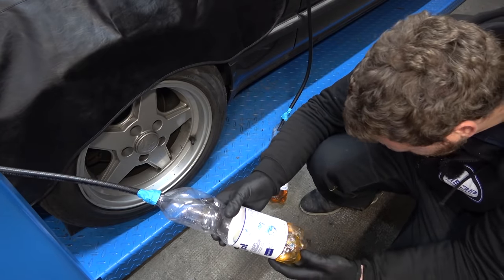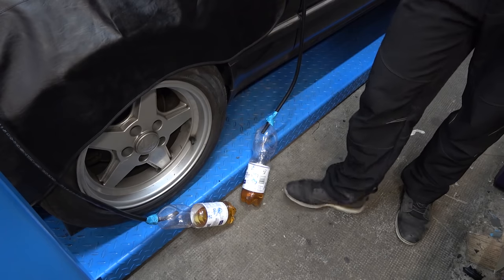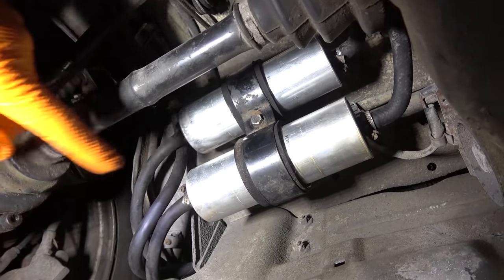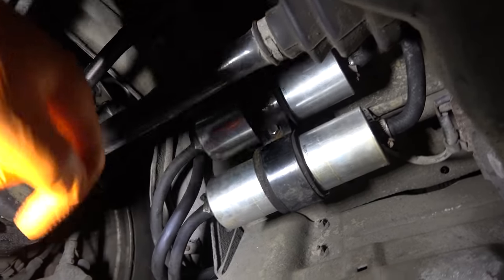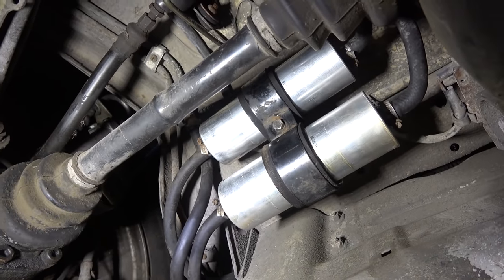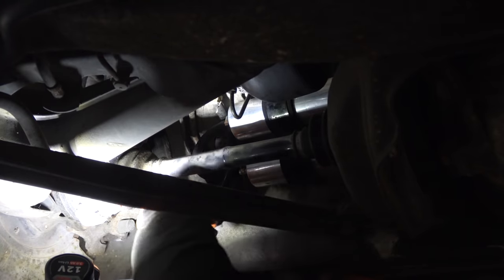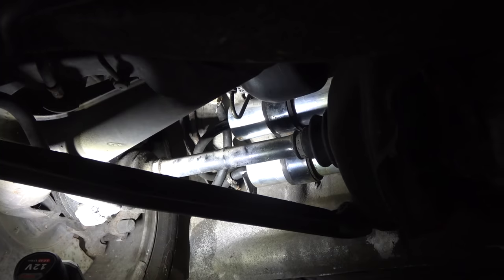The important thing is there's no sludge or small particles of crap — that's good. Just to make sure the fuel pumps are actually good, I'm going to test the fuel pressure. These are the fuel filters — I'm going to replace both of them. You can see the date 2014, when the previous mechanic replaced them. I also want to replace these rubber lines: two feed lines, a return line, and two small rubber hoses. I'm going to disconnect them one by one, let the fuel drain, and then disconnect them on top one by one so I don't get them mixed up.